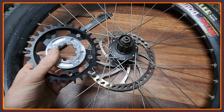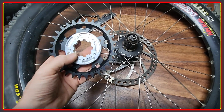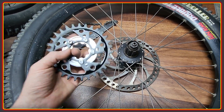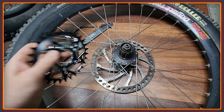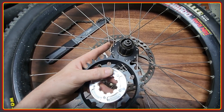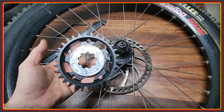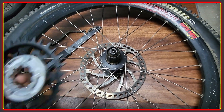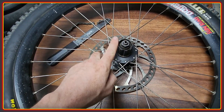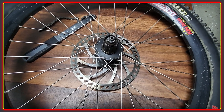We're actually going to be able to try out something that was made by Johnny at 49 Machine. He's made this adapter so we can use the front sprockets on the rear here. So what we're going to do is space out this gear and put it in an absolutely perfect, bang-on-the-middle chainline for a single speed bike.